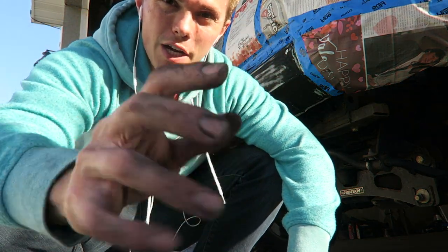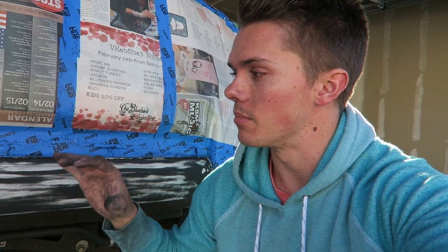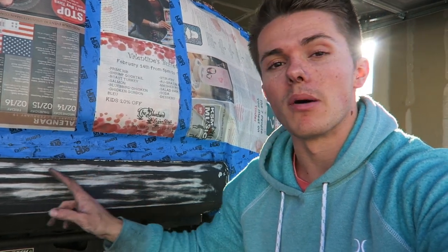This is not a very clean job — because I'm just repainting this black, I'm not sanding it completely down. All I'm doing is making sure I've gotten all the rough areas taken care of and smoothed out, so it looks like a smooth surface. Then I'll get a rag and some acetone and clean the bumper off so it has a clean surface for the paint to stick better.